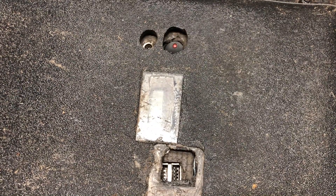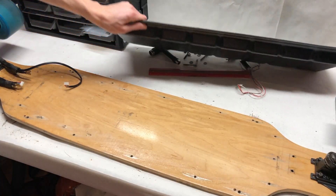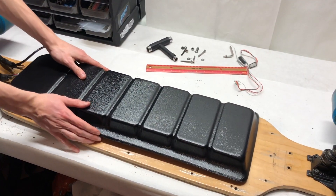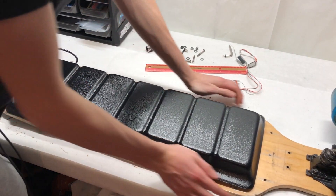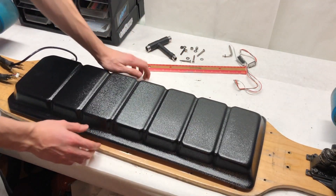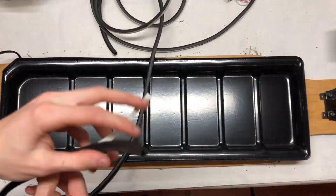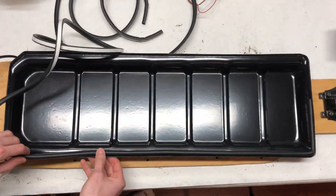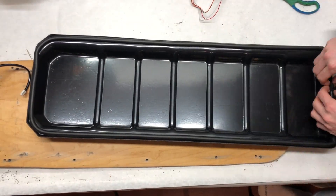The enclosure holes are also starting to wear down and allow debris into the enclosure, so we're going to be changing this to a new enclosure from West Coast Standard, which is going to make this build look super nice and fit the pack perfectly. This is the Fishbone enclosure — it's the longest single-piece enclosure that West Coast Standard sells, and it's absolutely perfect for this application because it's made for a really long battery such as the 10S 4P, and also looks really cool. The first thing we did was apply a gasket around the edge of the enclosure so that it'll create a seal when there's pressure between the screws and the deck, and water can't get in.